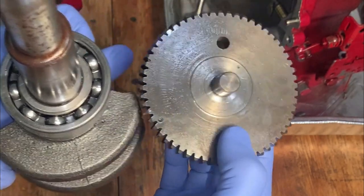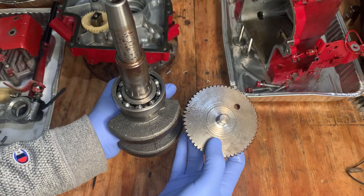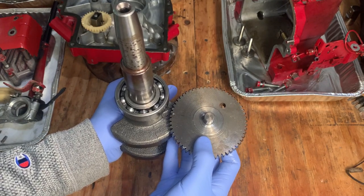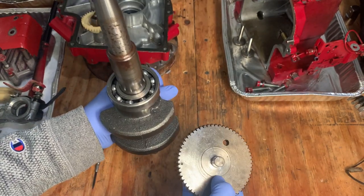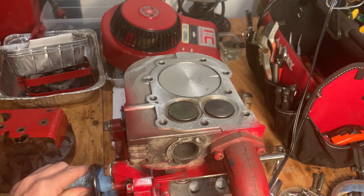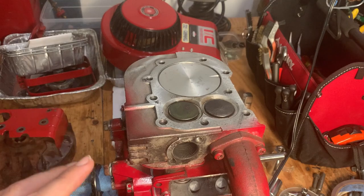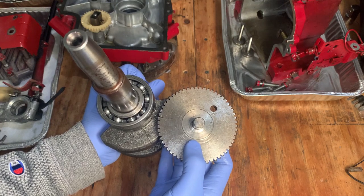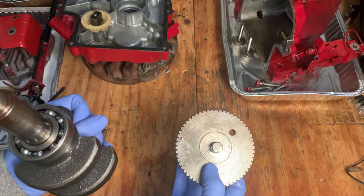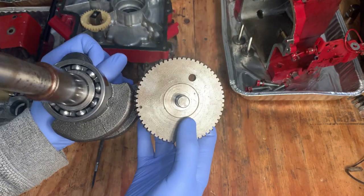It is probably a pretty common mistake. I did double-check it — I put it back in the way that it was, and then I put it back in the way that it should be. I double-checked the valves when the engine was switching between the exhaust and the intake. At that point, one valve is closing and one is opening. That should happen at top dead center when that switch occurs, and when I timed it incorrectly, that was slightly off. So pretty important thing to note if you're taking one of these apart — make sure you understand how the dot works on the counterweight.